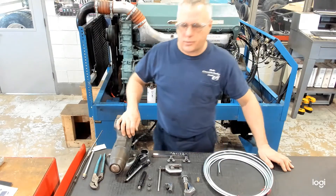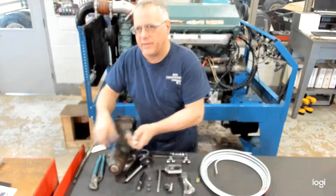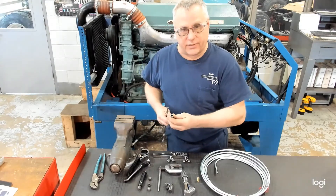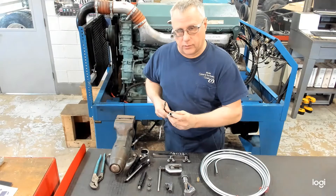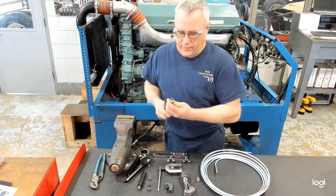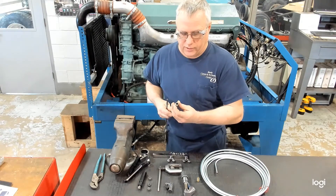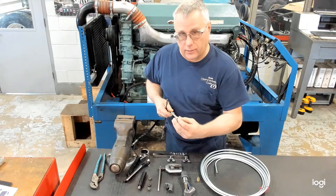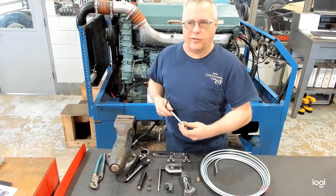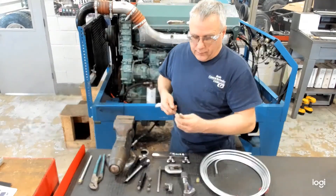In the video today I want to demonstrate how to double flare steel line, but first I want to go over the different types of steel lines you may run into. What we're going to manufacture today is this style here — a double flare steel tube. It's folded in on itself at a 45 degree angle, and the nut which comes up against the back of it also has a 45 degree flare. When it's tightened it will crimp or pinch that flare against the inside of a fitting and it will retain fluid such as brake fluid or fuel.